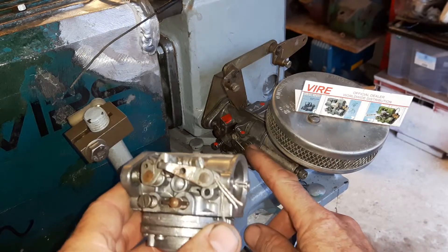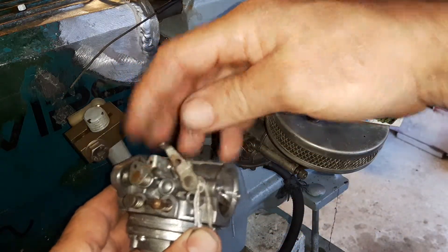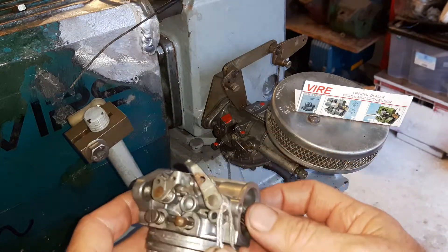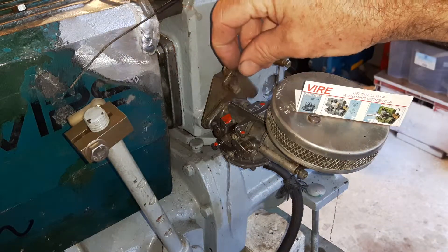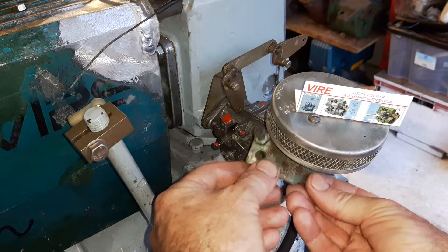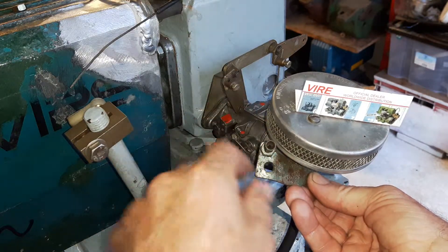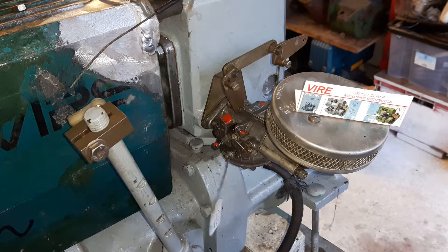Now there are two solutions to this. Either I can fit the older style shaft onto a new carburettor — you'd want a shaft like this instead of this; I can change these pieces around. Or what I've seen some people do is instead of having the operating bracket here, they'll fit a bracket to the bolt on the air housing so that it operates at a more favourable angle for that long lever. It just means changing the way that the cable comes in.